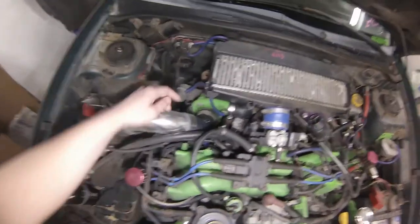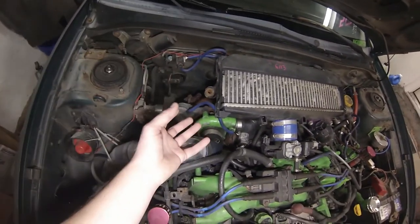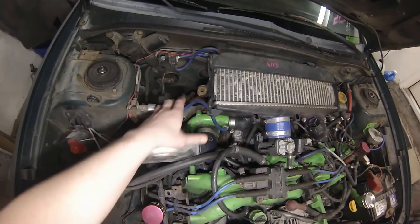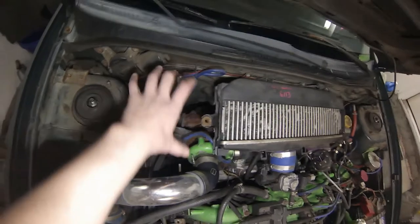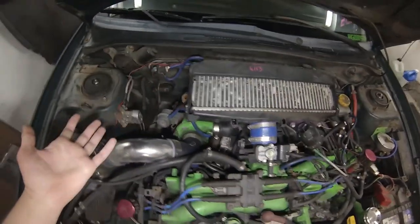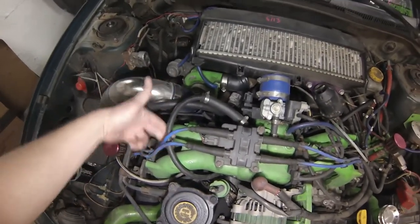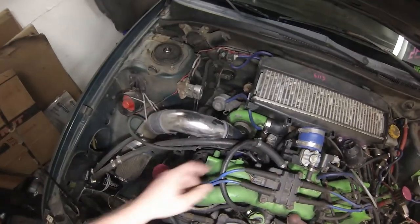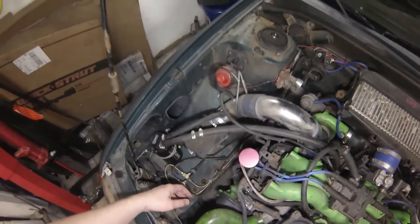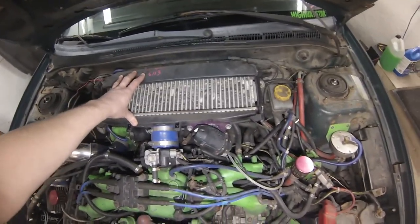To make it run the turbo, there's a WRX TD04. It's been custom mounted with a custom up pipe to meet it in this location. The down pipe has been tilted and cut so that the turbo actually is tilted back a little bit. The main reasoning for that is so that I could pass through and not have to think about going underneath the intake manifold to get airflow to the inlet of the turbo. So I've just got a nice little cold air pipe, basic filter, catch can is installed. That's all routed up to a 2006 WRX intercooler